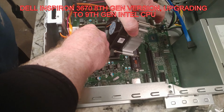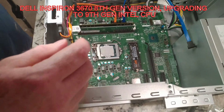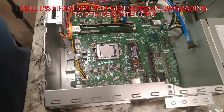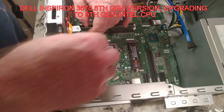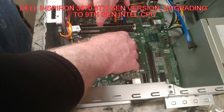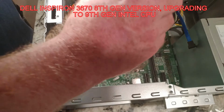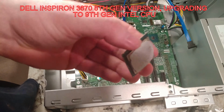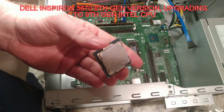Okay, so we want to disconnect the CPU fan connector. And I'm going to do that now. You can do it before you disassemble this, but in this case, we left it there. Alright, so I'm going to pull this tab back and lift up. And there's tools to do this a safe way. So the way I'm doing it, and you definitely don't want to touch this during winter time when the static electricity is high. So we will grab our i3 in a second.